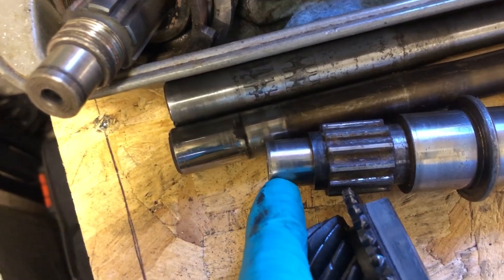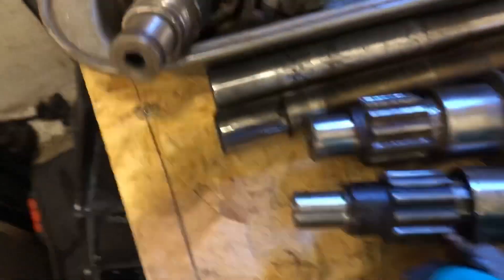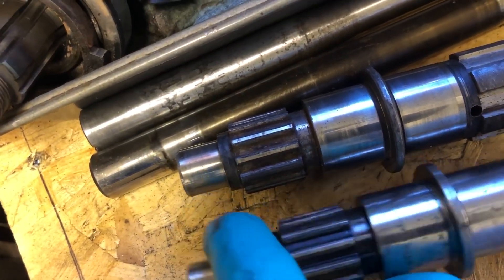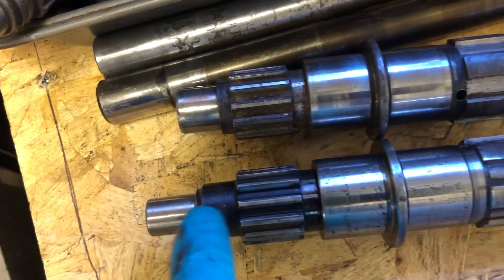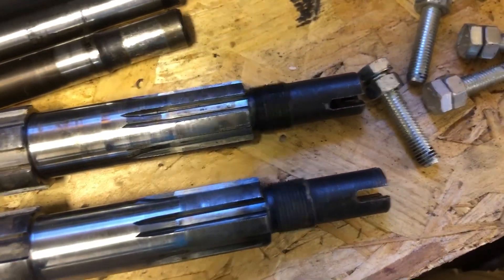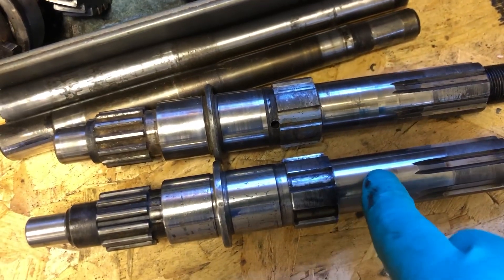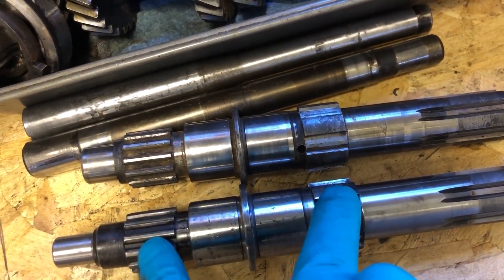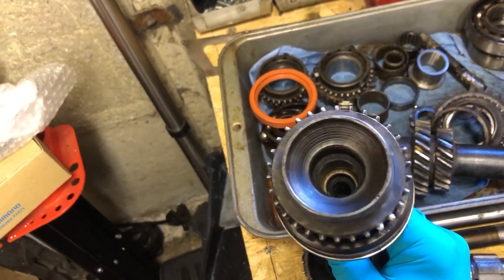On the A plus you run a big bearing here; on the pre-A plus, if you put them side by side, you run a small one - that's a 14mm I think, and that's an 18 or 19, I can't remember which it is. This nose of the bearing goes in a lot deeper into the gear, and it's a different diameter. Otherwise, they are identical - you can interchange the ratios and first gear, and even the synchro hubs I believe are the same because it's a four-synchro box. The difference is the first motion gear, because this has the bigger diameter for the bigger bearing and the one that came off the car has a smaller diameter bearing hole.